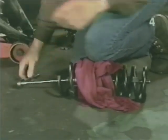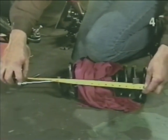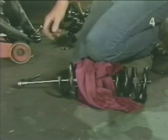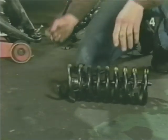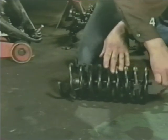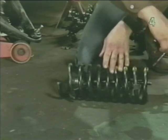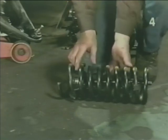The purpose for having everything prepared before putting the spring in is so that we can have the spring under compression the least amount of time during reinstallation. Our spring is compressed back to the disassembly length. Now we need to lubricate the spring and install it in the chassis. Once again, always keep the spring ends facing away from you or anyone else.